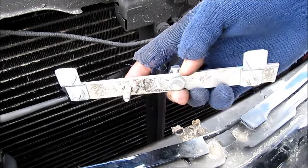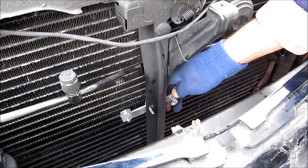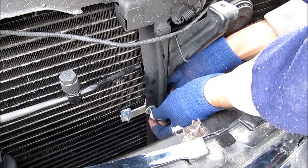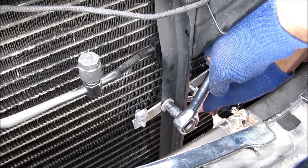I've got my hardware installed on my fabricated bracket. I'm going to go ahead and install that on the rad cradle using a 1/4 inch bolt, a washer, and nuts. I'm going to tighten down this bolt making sure the bracket is straight.